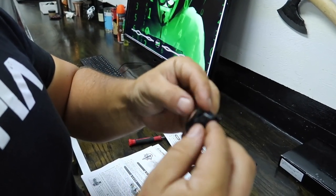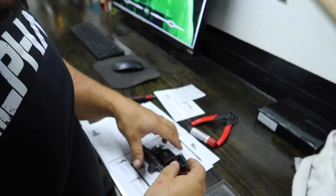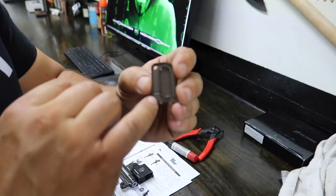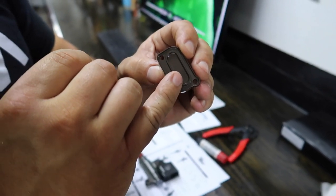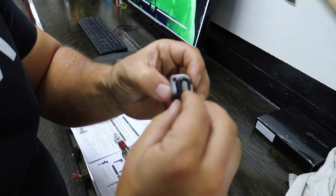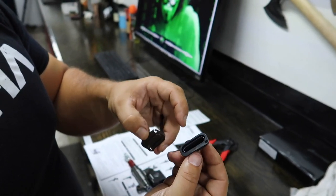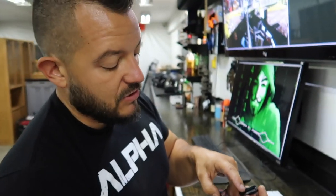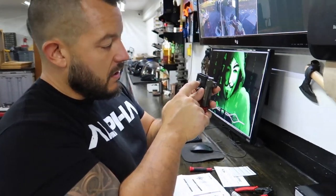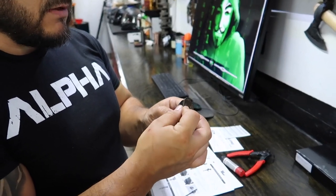This simple little gasket will take up the slack — it'll push down and take up the slack of that fluid. So you don't have air between your fluid and your seal, that area is filled with rubber instead of air, and all the moisture ends up in this little cavity. For people who service brakes a lot, when you open up the cap you'll see either water or moisture bubbles. At the top of the lid they have this little machined piece. If you get equal temperature and pressure between outside and inside the top of the cylinder, it'll actually dry that water on top. That's also why they have you filling it to a certain spot — you don't want it overfilled.